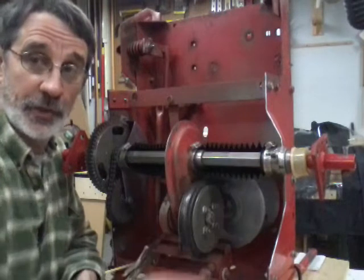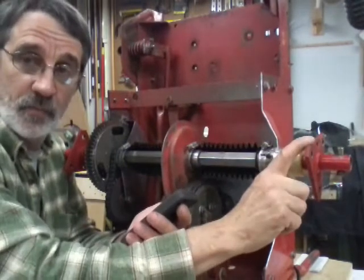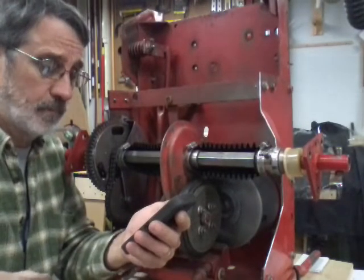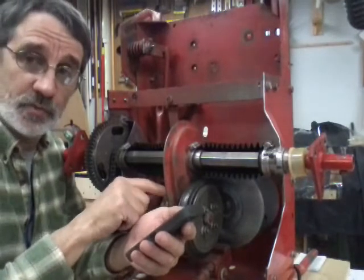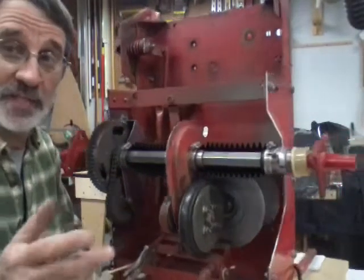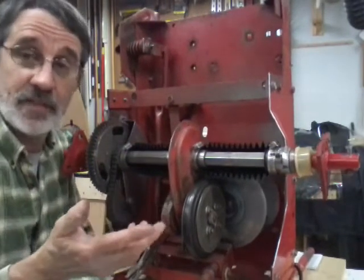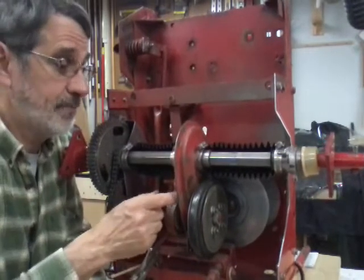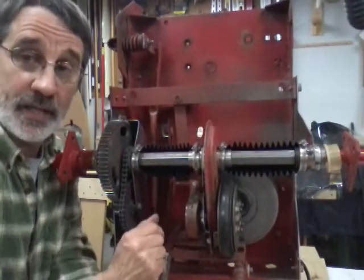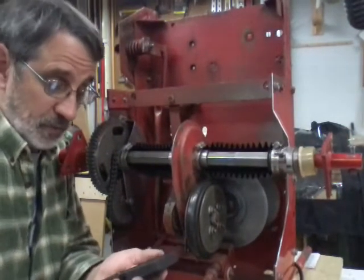The next one is about getting the wheel flange off — I told you how to slit it and pop it off. And replacing the chain: if it's as bad as this one, go ahead and replace it now that you've got it torn down. I wouldn't trust it — it might last another 10 years, you don't know, but at this point I would put a new chain on because if it gets much worse it's going to wear your sprockets out and you'll have to replace everything.